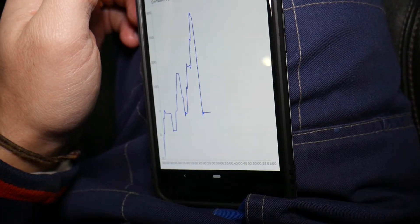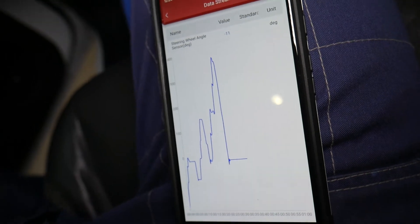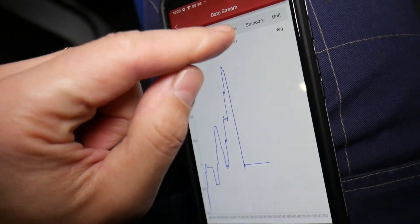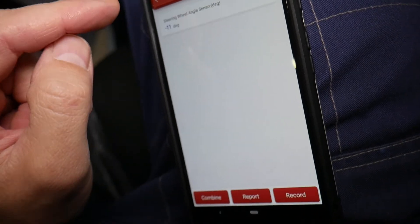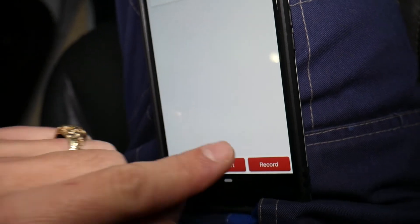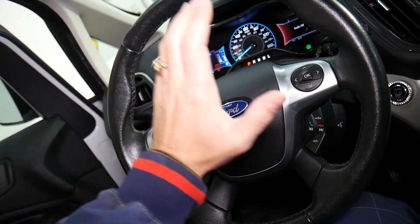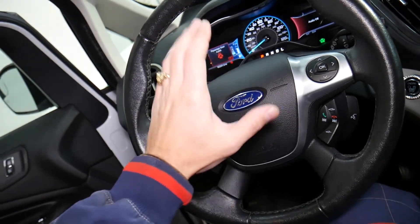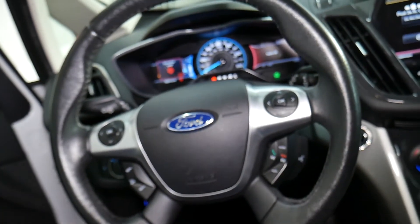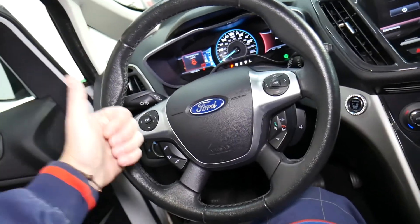If it matches, it's not a bad sensor. Sometimes sensors may not work intermittently when you hit a pothole or something comes loose. You can activate it like that, but you can also click record and leave it running while you're driving — it's going to record everything. Later, if the light turns on for a malfunction in the steering angle sensor, you can stop the vehicle in a safe place, check the recording, and see when it occurred to find out if it's good or bad. Hopefully this video is helpful — thank you for watching and see you next time.